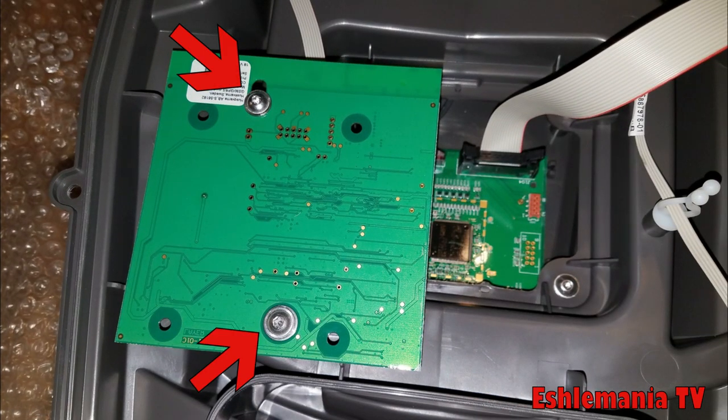This is the mounting configuration for a 315X, a 315, a 310 — the older model 315X millers. They did not come with the Connect board already installed, so you have to install it yourself. Or if you're upgrading a 315X that already came with the Connect board and you're going from 2G to 3G, this is the board to replace. It uses a slotted hole and the hole in between the other two holes used for the 430X or 450X, mounted off to the side of the back of your display screen.